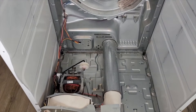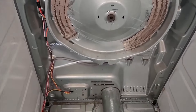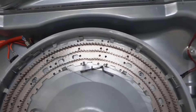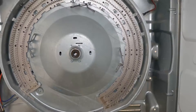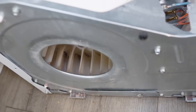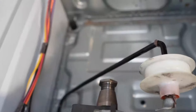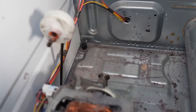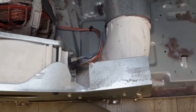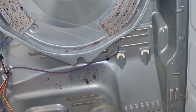These are all the major steps for dealing with a Hotpoint dryer that is not heating or drying your clothes. If everything looks okay, make sure all wire connections are intact and not unhooked. Another thing to check for would be a floating neutral situation — this is where the dryer powers on and runs but your voltage drops when it's actually in use. You would test this with a multimeter at the terminal block while the unit is running, and you need to get at least 208 volts. If the voltage suddenly drops when it powers on, there's an electrical issue somewhere between the outlet and the breaker, which is beyond the scope of this video.